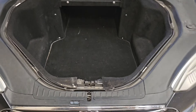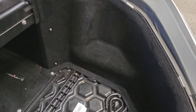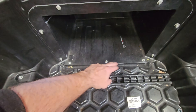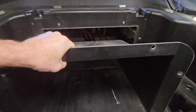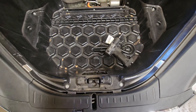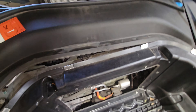Next, remove this cover and then remove the carpet like so. Take the side piece and carpet out as well. Now we're going to remove the plastic — take out one, two, three, four, five, six, seven, eight ten-millimeter bolts and nuts. Then come over and remove this cover here — it just pops up like so.